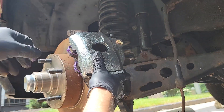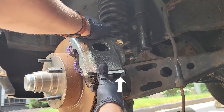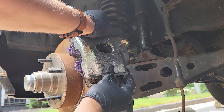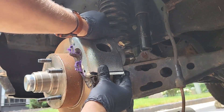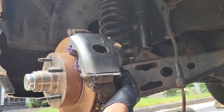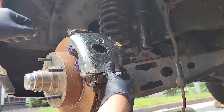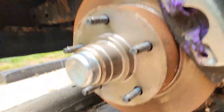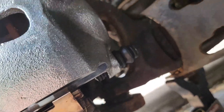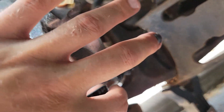Now let's figure out the issue. Watch this area — the slide pins and boots are too far in and need to be pressed out. So I'm going to press both of them at the same time with my fingers while carefully pushing the caliper in with my left palm and right thumb. The brake pad clips slide right over the caliper and into place. Here's a better shot of those brake pad clips. That's how the slide pins and boots should look — they should be pressed outwards.